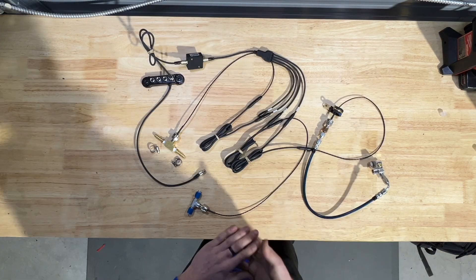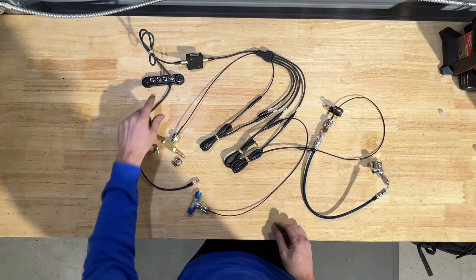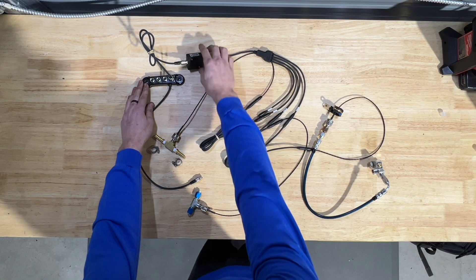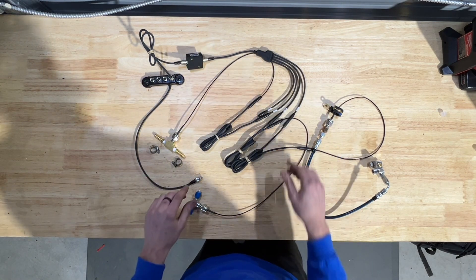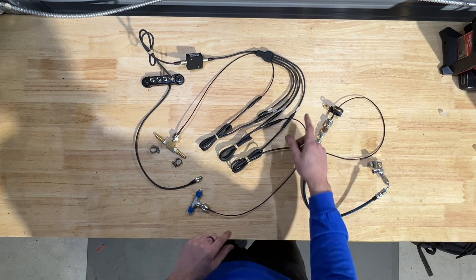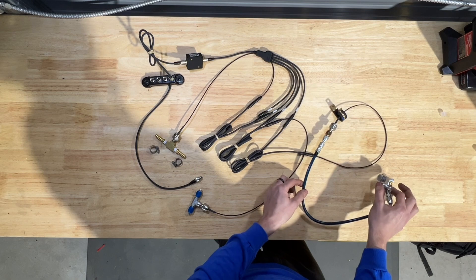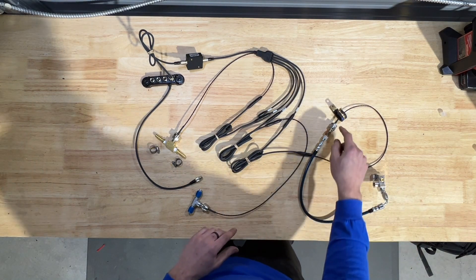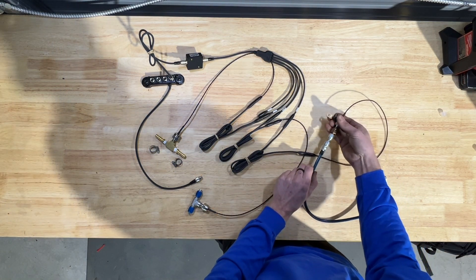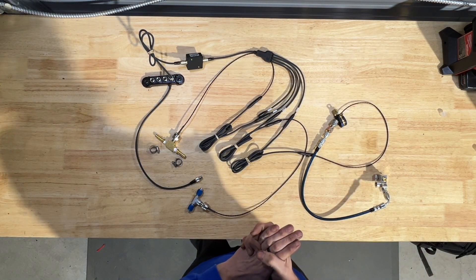So we have a road map: the data hub goes to the Solo 2 DL. One port goes to the Smarty Cam. Then the analog CAN converter splits off to its various sensors - channel three is fuel pressure, channel two is brake pressure, and channel one is oil pressure, which has the remote mount line so we can attach that sensor not directly to the oil filter housing. It comes with a Adel clamp that you use to mount it at a location of your choosing. Now to get this in the car.